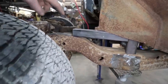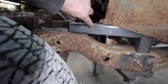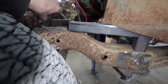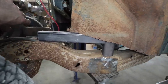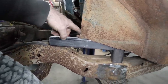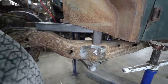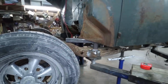So the plan is I'm gonna cut another one of these. We're gonna tee it off, weld it. I'm just gonna do just a slash cut on here just so it looks pretty. But I'll probably leave it open. So if dirt gets in there, it can at least go out. I don't know. No, I'm not sure. But anyways, we're gonna make two of these. Either side, done. Punch the hole, slash cut. Buzz, buzz, buzz. Cut that plate up, and we're gonna use it just as a gusset on the side here. We'll use some of it, just for extra strength for everything. Mint, like it.